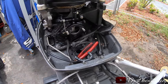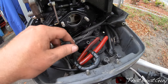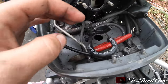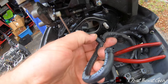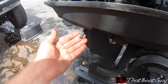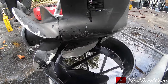On these military engines they're designed to be sunk, and there's a system that allows the crankcase to be drained if it's filled with water — but someone already disabled that. Instead of taking the hoses off and putting a vacuum cap on, they literally bent the hose and put a zip tie on it. I'm going to fix it properly. The engine is running pretty good but I'm going to need to put a new impeller in — the gear fluid is old but not milky.